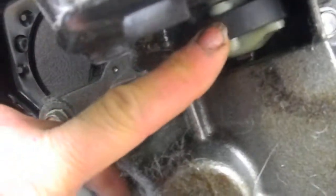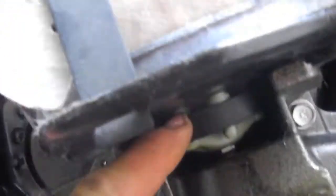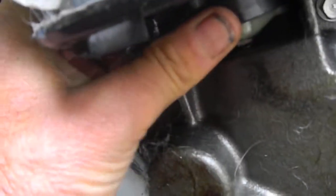That clunk can be solved by lubricating the brake. I learned the hard way, replacing several drive couplers. This is the drive coupler here — if both the transmission shaft and the motor shaft are not turning when you turn this, then you have a bad drive coupler.